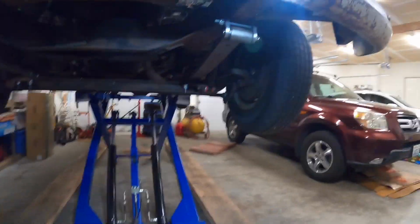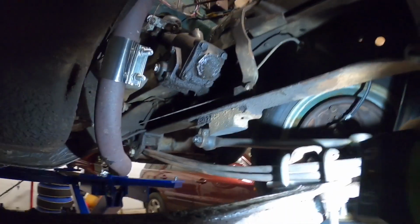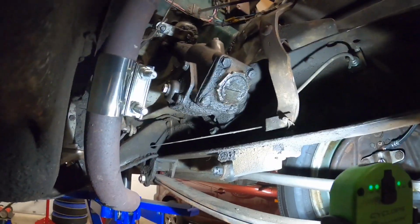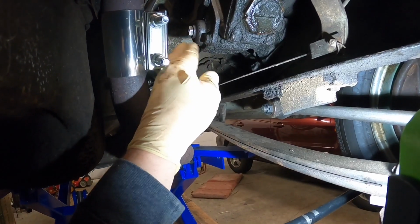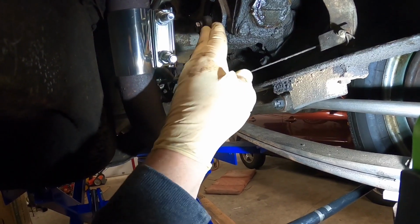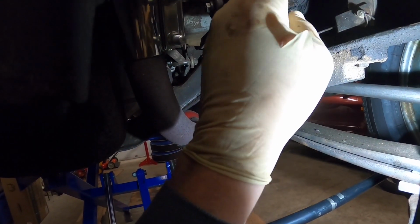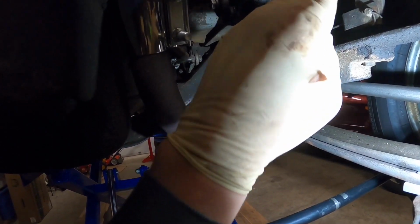And I'll show you what we're gonna do. All right, get some light on there. All right, there's the steering box. On the side here is a 5/8 nut and a screw on the inside of that, and that's your lash adjustment. On the bottom here with this larger lock nut, this is your bearing slack adjustment.